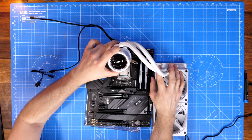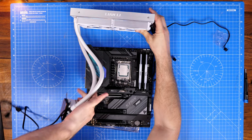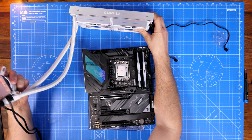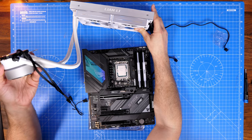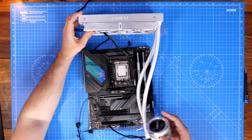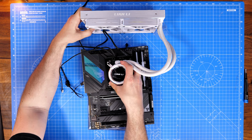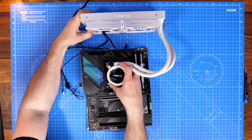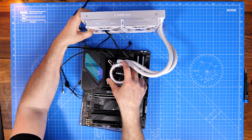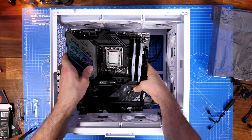You can also mount the radiator on the top of the case — either with the pipes on the left or flipped with tubes on the other side. Think about what the radiator might interfere with, like RAM RGB visibility. If tubes are at the rear and you have an exhaust fan there, the tubes could block airflow. In my case I'm side-mounting the radiator. With three 120mm fans on top it wouldn't make sense to put a 240mm radiator there.